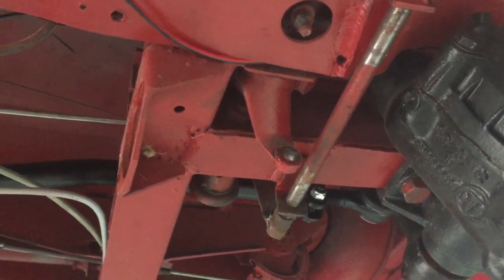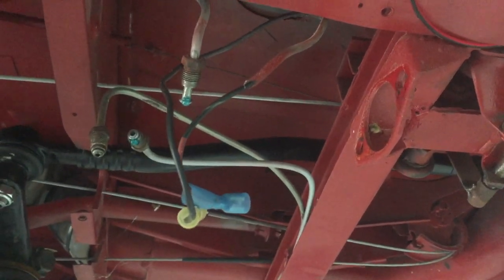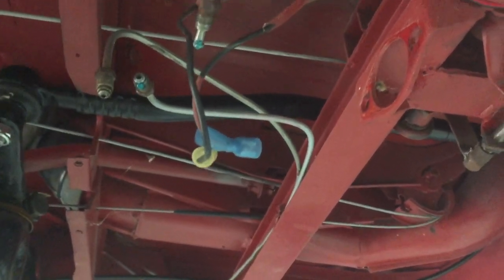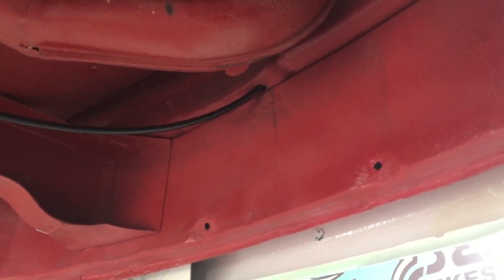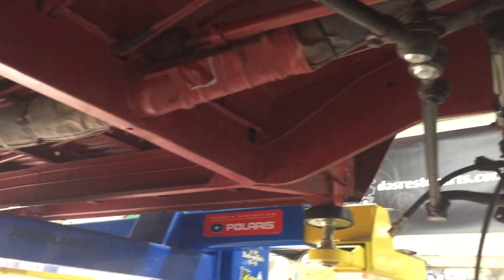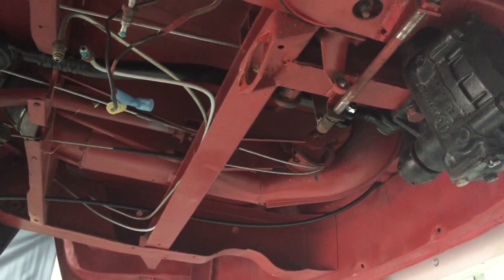So it's obviously just goes back in that same location. Now, what has to happen with the brake lines is they will have to be slightly modified to fit the ports where they need to go in. And obviously, we need to still bolt the brake booster up there and put some riv nuts in it and make a bracket. And then obviously do all the rest of the plumbing, the vacuum line, which is going to run down the chassis rail, down the side down there, into the engine bay. So let's get the master cylinder in position and move on with the job.